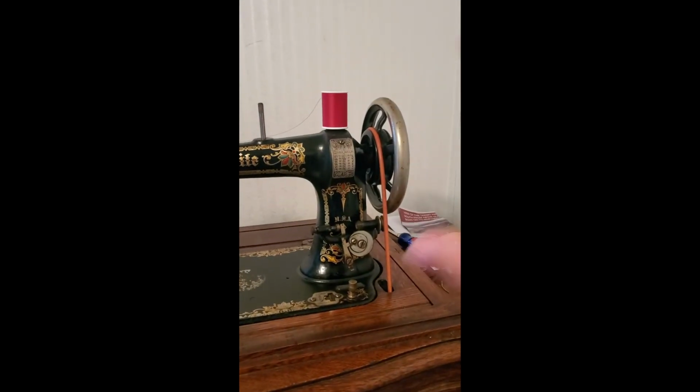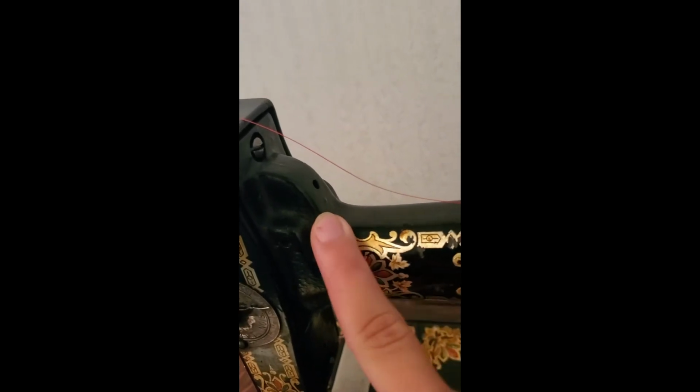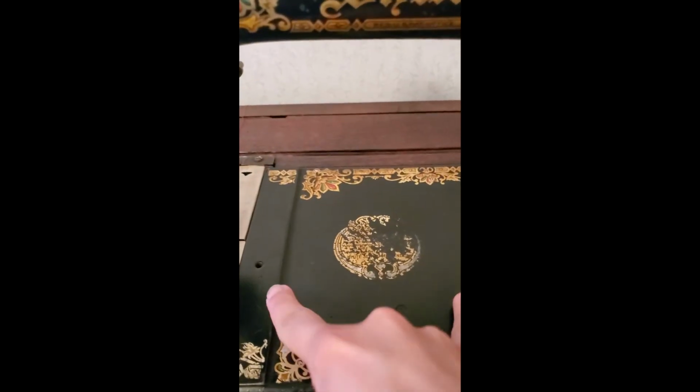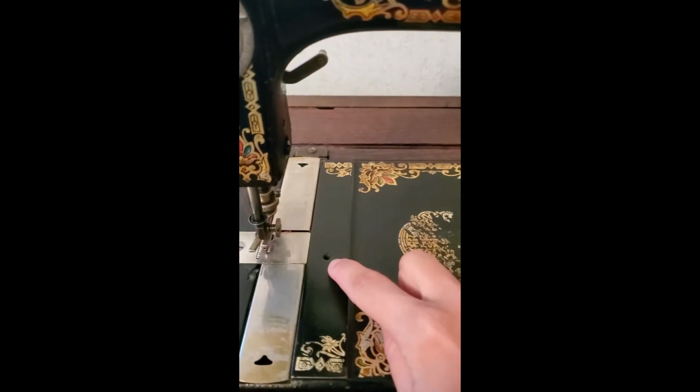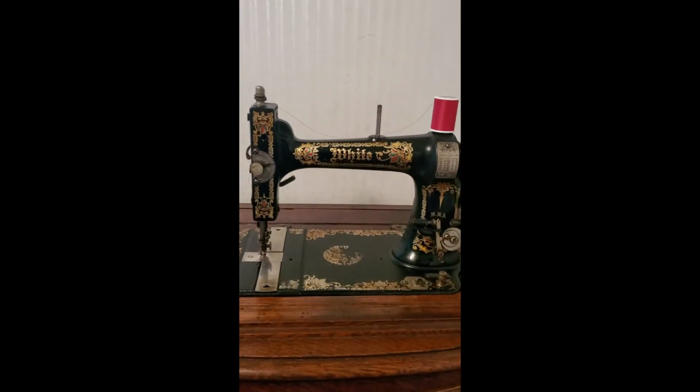When it comes to oiling it, you definitely want to hit the parts down here at the bottom, especially where it attaches to the pedal, because it's a metal on metal spot. Same with both sides of the pedal itself. I always make sure that I get the gears or the opening here around the wheel well. And I try to get where the drive bar attaches to the drive wheel, but doesn't always work. There's usually oil everywhere. But then there's all of these parts of, everywhere there's a little opening or a hole to put something in, that is where you want to put oil, even in these spots here. That one gets clogged pretty easily, but that one especially goes to everything under the machine. You definitely want to do that one. But there are 8 spots to oil on this one.